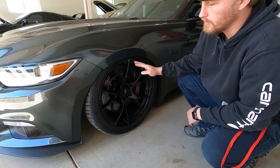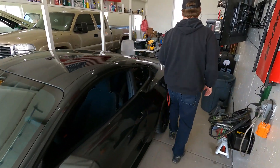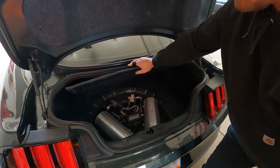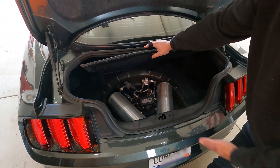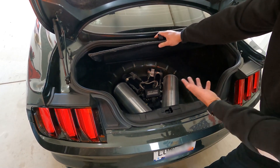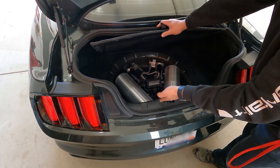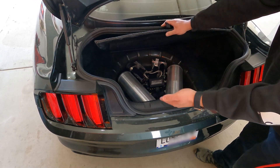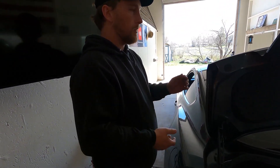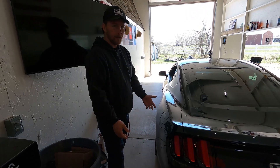This definitely looks like a suspension that shouldn't work, and one of the more controversial choices I made on the build — at least in the Mustang community — was going with air suspension. I have two tanks, two compressors, and a valve body, all nicely tucked away underneath where the spare tire would go. This car didn't even come with a spare tire, so I didn't lose anything. There's actually a valve on the bottom so I can use these tanks and pumps to fill up the tires if I get a flat.